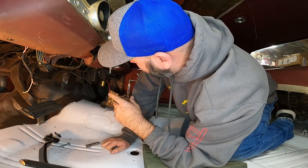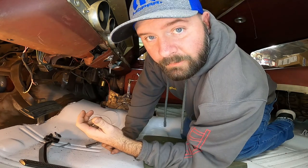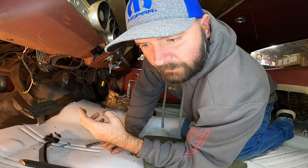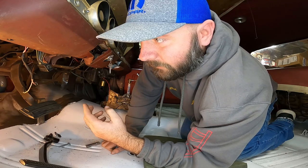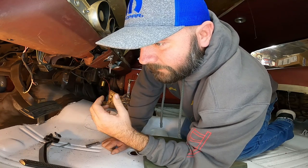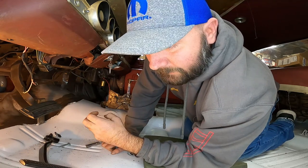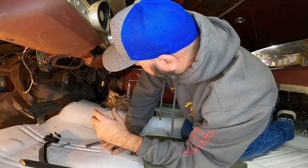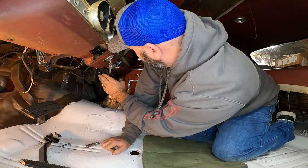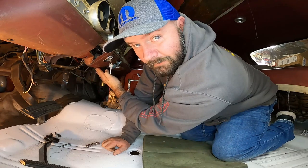And then I'm thinking, I got an air fuel mixture gauge, oil pressure, and voltmeter. Air fuel, because we welded a bung into the header collector to help us with our tuning. So that'll be under here. I'm going to take this radio out. I'm going to see where else I can mount it, because I want to put that gauge cluster right here.